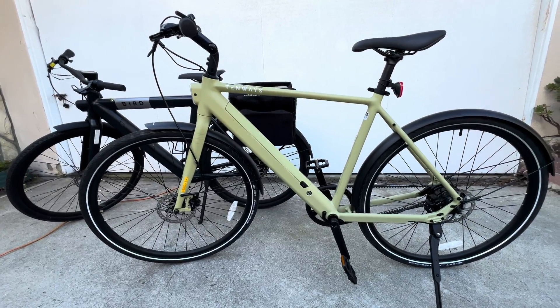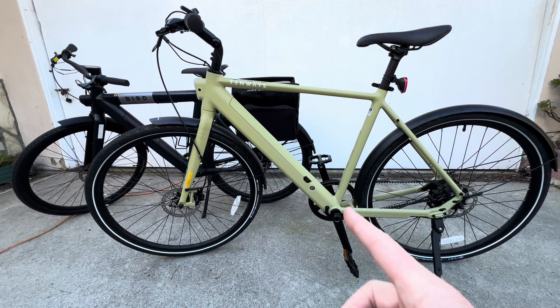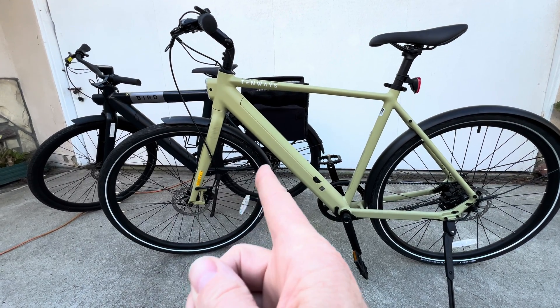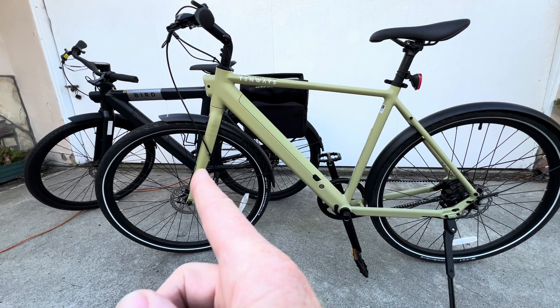Comment, like, subscribe. There are links to both of these bikes in the description. I really like the 60 by 22 setup if you've got a bike that maxes out at 20 miles an hour. I think this is more Euro spec — like in Europe it's 15 miles an hour, so 55 by 22 is probably the perfect gearing for a bike that stops helping you at 15 miles an hour.